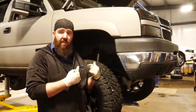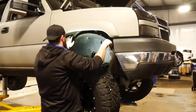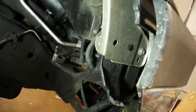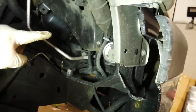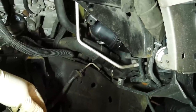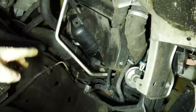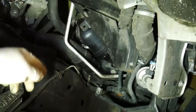Now we come around and we're going to get our fender liners out because there's a whole lot we need to get to inside both sides of the fender wells. We're going to start off with the passenger side. Once we're into the belly of the beast here, we've got a couple of different things that we're going to be doing. One is going to be taking loose the bracket that goes between the frame and the front bumper. We've also got our intercooler hose to get off, our lower radiator hose that we'll need to get off, and we're going to need to evacuate some freon out to be able to get our AC lines off. Once you get the intercooler pipe off, there's going to be some trans cooler hoses in behind that portion, so we're going to have to get the trans cooler lines off of the radiator as well, because those go back onto the transmission and the radiator is going to be going up with the body.